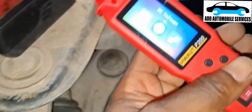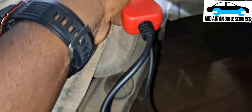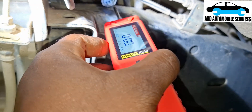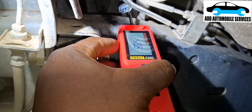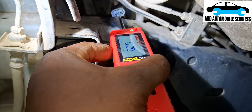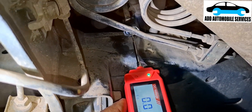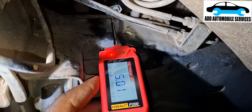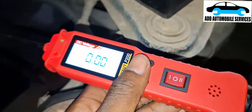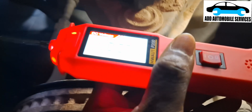With this machine, let me select DC volts. I have to measure the voltages. I think this one will be ground — and I'm measuring 4.9 volts. Let me measure the second one — I'm measuring 0.1, that's ground. You can see the green light is on. The middle one is ground, and this should be my power, which is 5 volts — you can see my test light is also up. That means I'm having all my signals, so the issue is from the crank sensor itself. I have to replace the crank sensor.